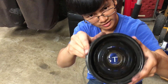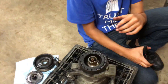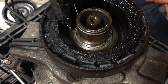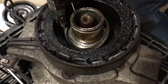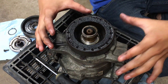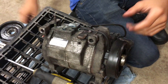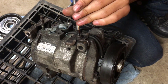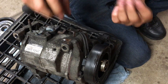This is what the pulley looks like from the back, from the inside, and from the outside. Next up is the clutch coil — the stator — what we're trying to replace. What's keeping us from taking it out is another snap ring. As you can see, we're going to place it in — you can see the two notches — then we're going to squeeze. Put that aside for now. You should be able to pull it out, but there might be a tight connection for the wires. In order to give yourself some room, you might want to take a screwdriver and loosen the wires, because when you try to pull it out, the wires might not give you enough room. That's taken out now.